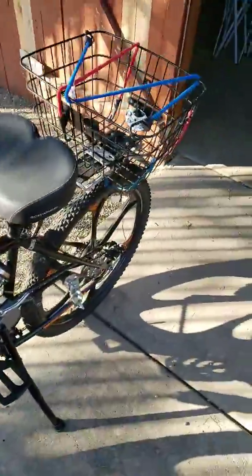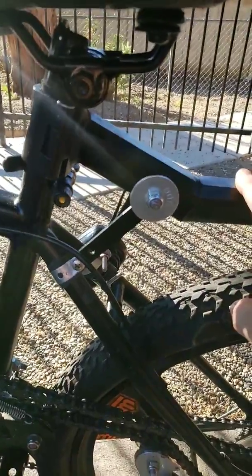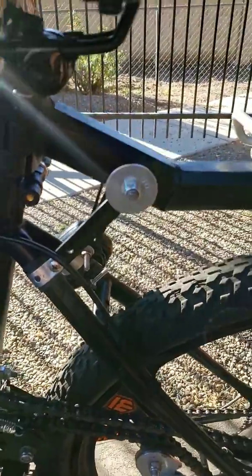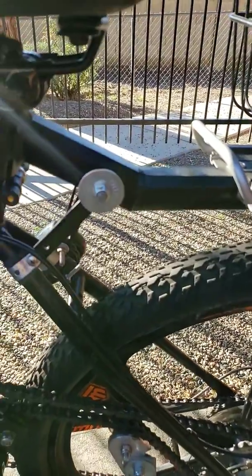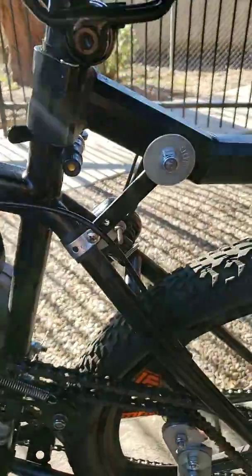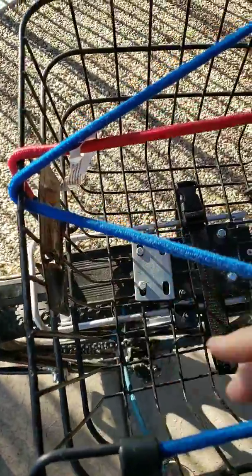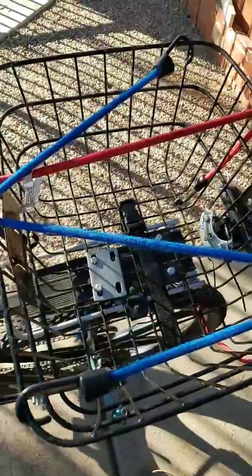And the rear basket was kind of a convoluted mess. I got a regular seat and seat mounted basket, and it didn't hold right, and I thought about it and thought about it. I finally decided to put a couple of extenders that were bolted right to it and mounted to the frame, so it gave me a good solid mount. And then I bolted my basket right down to the plate, and it's being held together on the actual plate rail, as long as it's being held together on the plate here. So it's being held together in 2 different spots. It's pretty solid.